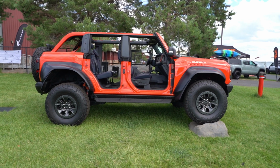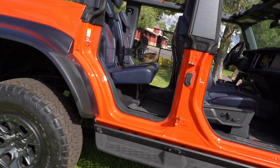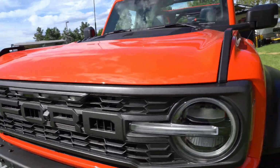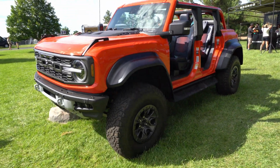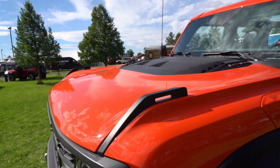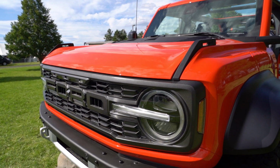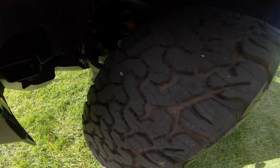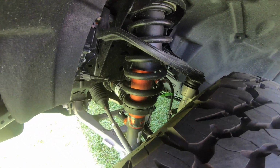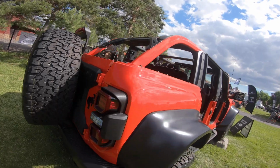Finally, the Bronco Raptor. I have to say this Bronco looks awesome. And if you're not going to be hammering desert trails in an F-150 Raptor, why not do it in a Bronco Raptor? The width of the Bronco Raptor is very noticeable. Ford took note of all the things that work for the F-150 Raptor and put them into the Bronco recipe. The power plant is a 3-liter EcoBoost V6 paired with the 10-speed automatic transmission for pre-runner speeds. The suspension is bumped up to HOSS 4.0 with Fox Live Valve 3.1 internal bypass semi-active dampers. Basically, this helps with travel at speed, with 13 inches of travel up front and 14 inches in the rear.